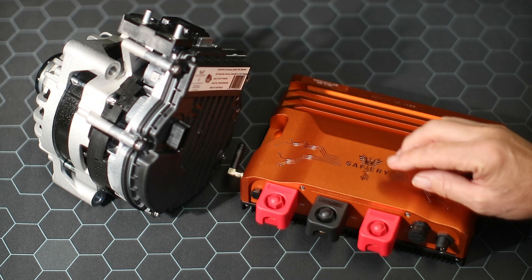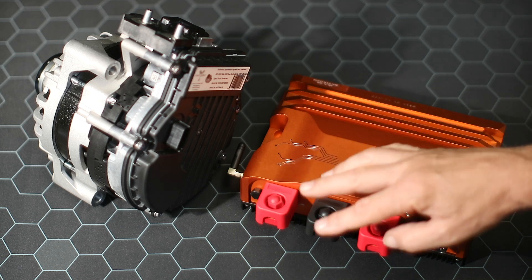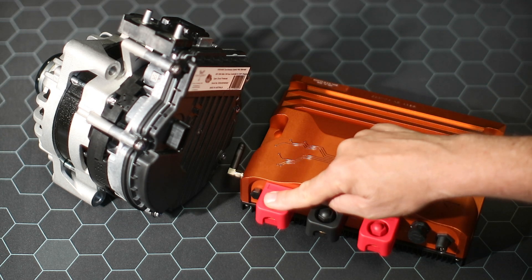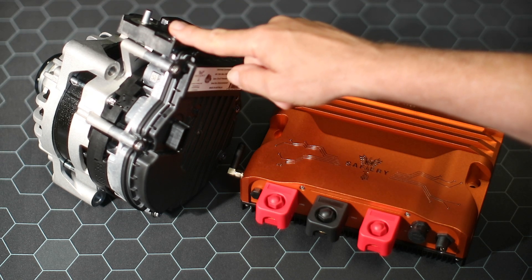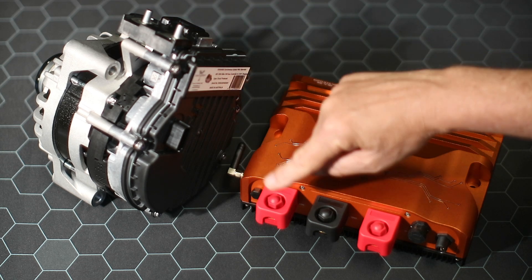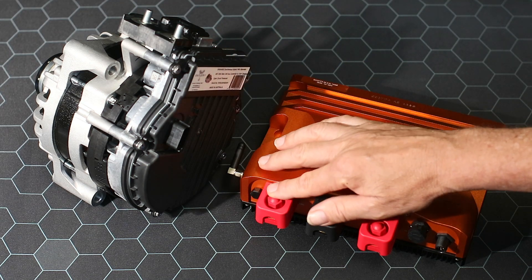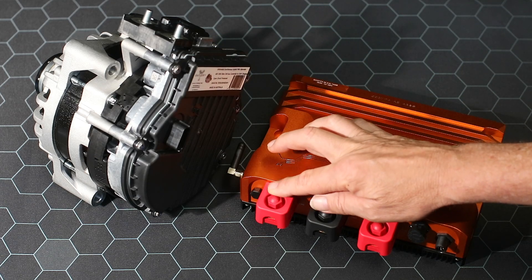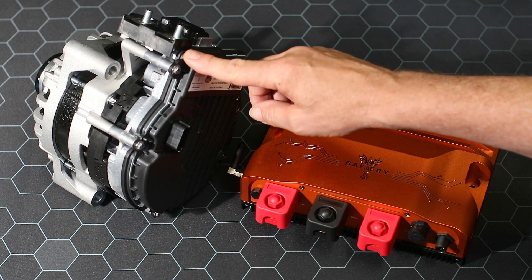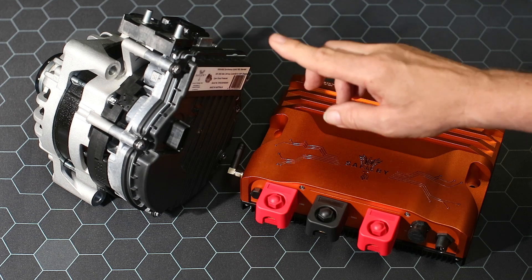There are about 10 different combinations of power here. Let me step through a couple of them. Let's say this is on a 12-to-48-volt system and you've got a different 48-volt system in your truck than you do in the towed caravan or trailer. This 48-volt output here can charge the technology in the truck, and this unit here can charge the technology in the towed caravan or trailer. The big advantage of having them totally independent is that they can be at totally different states of charge, and you can drive them totally independently — this one via our app, and this one based on the charge current limit of the battery in the towed unit to give maximum power.